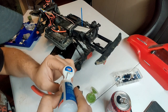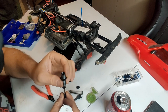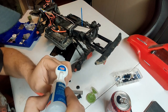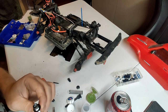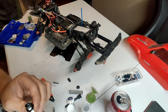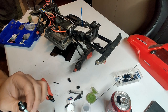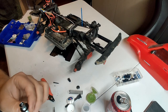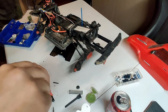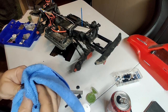I'm going to start putting a little in. I'm going to work it a couple of times, just the slightest amount of up and down, to get the air out from behind the piston. You build enough shocks and you start to get a feel for how much more it needs. So you're gonna put this together. Oh yeah, it's too full. Something's gonna gack out of there.